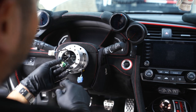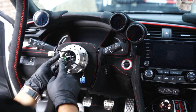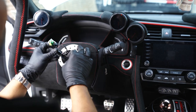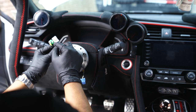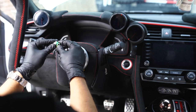These are five millimeter Allen head bolts. These two are two separate ones that I taped together — they were plugged into the OEM airbag. These have the two NRG two-ohm resistor error cancelers connected to them. It just has two wires sticking out and you're going to plug them straight into each little socket on both of the airbag harness plugs.